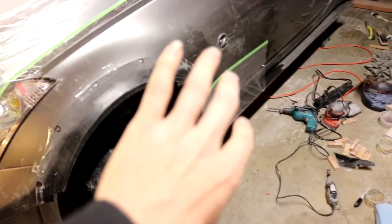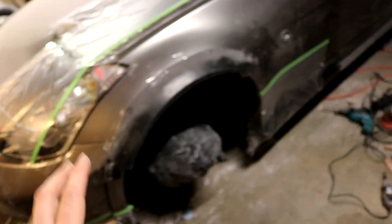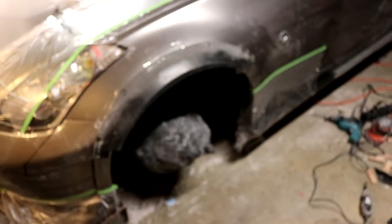After that, we're going to go ahead and get our clay out, start doing our sculpting in the back and in the front to get those details started. Then we'll go ahead and use the PVA to protect the clay, because we will then go in with the fiberglass and start doing all of our glassing. Once the glass is complete, we'll go in with our gel coat layer and start the refinement. We are moving along here, guys. Let's get going.